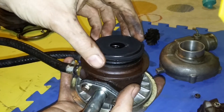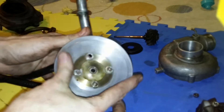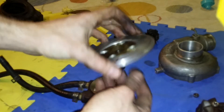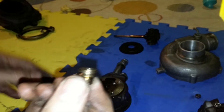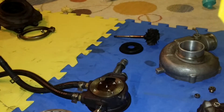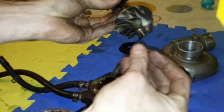Then there's a little plate here that comes off. This all stays — I'll probably clean that up. Take the four bolts out; they're star heads, I forget what size. Once you take that off, this little piece here will come out. There's one of your seals on that piece. I put it back on here, put the wheel back on, and put it back together so I'll lose nothing.